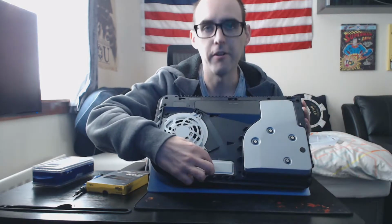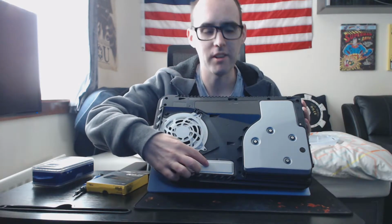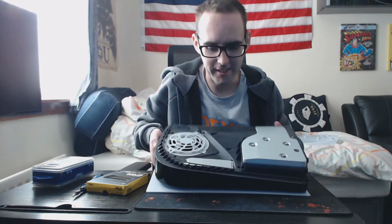This is where our NVMe expansion bay is, and that's the disk drive at the bottom of it. What we're going to do is remove this little PlayStation screw with our screwdriver. Not too difficult to do this, really, but it is one of the advantages it has over the Xbox. If you're familiar with PlayStation 4 or PS3, they had a little screw with the PlayStation button logos on it. So we just remove this little piece of metal right here.